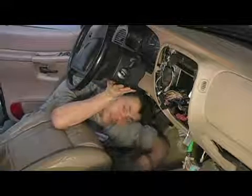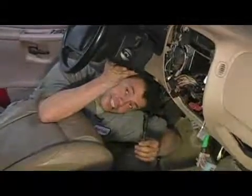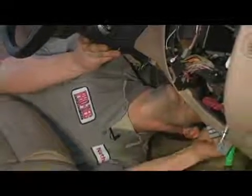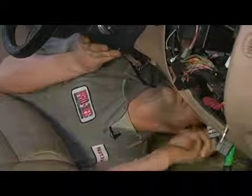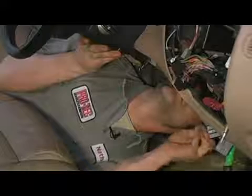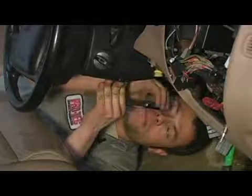You can see for reach, what I've done is taken and putting the nut inside my socket on an extension. So I can take and work that guy around up inside here. Alright, there's one. We're going to go ahead and get the second rear one.